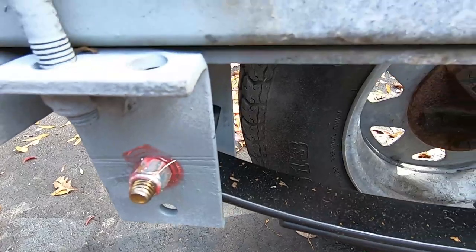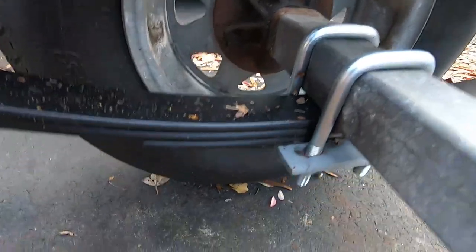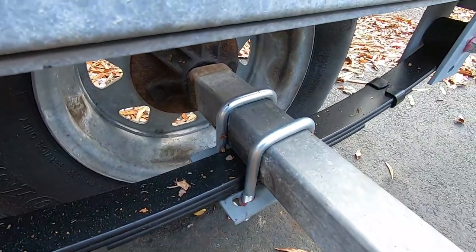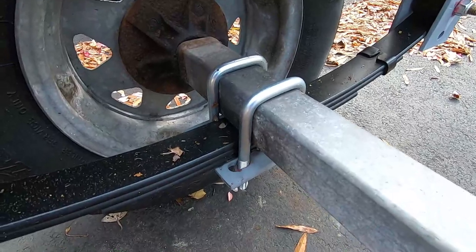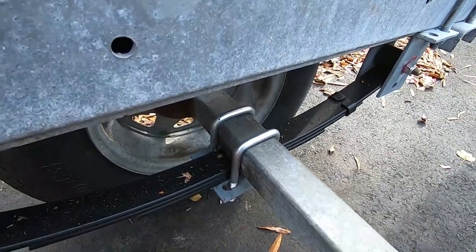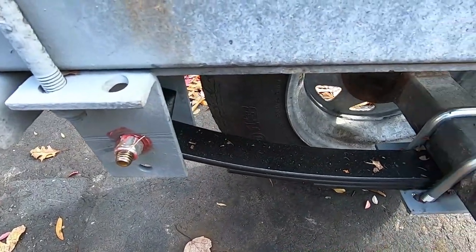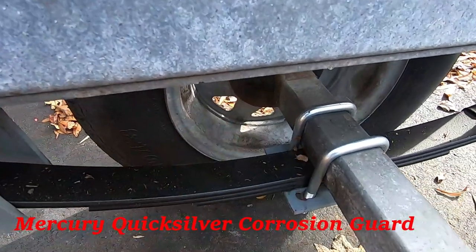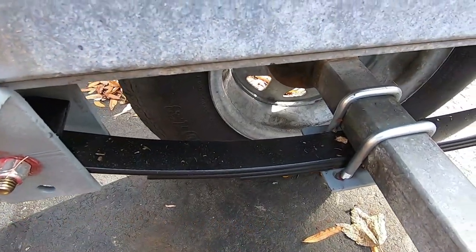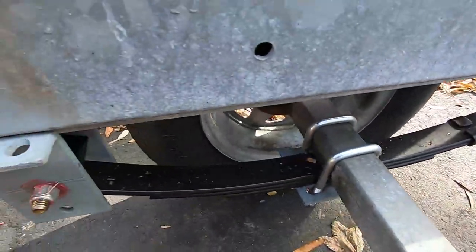You want to put the nuts on the inside — it gives a cleaner look from the outside. I reused the plates and got new U-bolts. For doing both sides, the total was $115 and that included tax. A good thing to do is put some heavy grease when you're putting these things on — makes it easier to tighten them up. Then I sprayed a corrosion-resistant spray all over everything to try to slow down any rust forming.